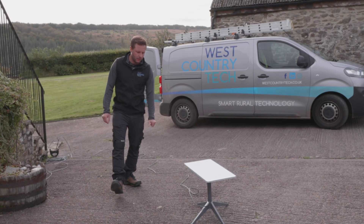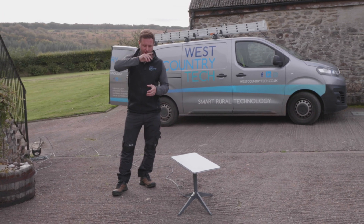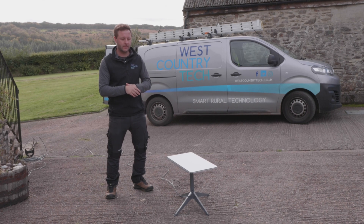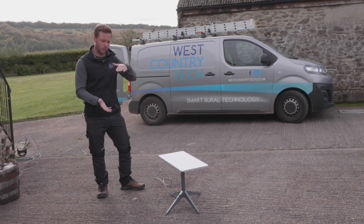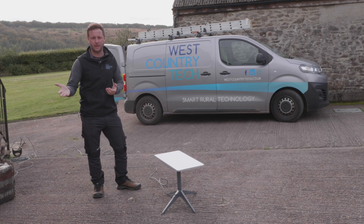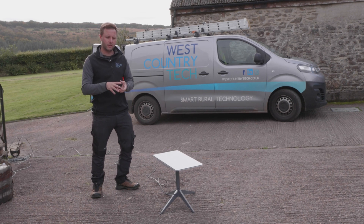The Starlink is now all connected up and temporarily fixed onto the base, with the cable run inside to the router plugged into the nearest socket. Starlink recommends facing it roughly north–south initially, but the dish will spin around and find its own alignment. Around three to four minutes after turning on, it aligns, twists, and latches onto a satellite. The connection going live varies — we've had it take two minutes, and other sites up to ten minutes. I recommend downloading the Starlink app, which shows when it's connected to a satellite.